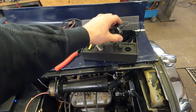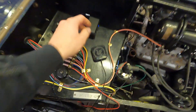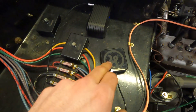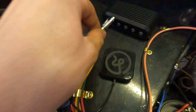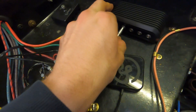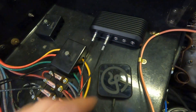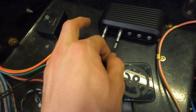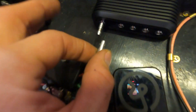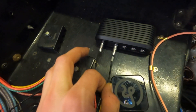Next I'll connect the GPS antenna because that's the easiest. The antenna is also magnetic on the back, and they said when the Hoots logo is facing up you have the best GPS connection, so I'll leave it right here. I'll just plug it in right here — it doesn't matter which port you put it in. The system is smart enough to recognize which kind of signal it is. These connectors are also great because you can't just pull them out; you have to pull this little thing backwards to release it. So if someone pulls on the wire, nothing happens — it's pretty safe.